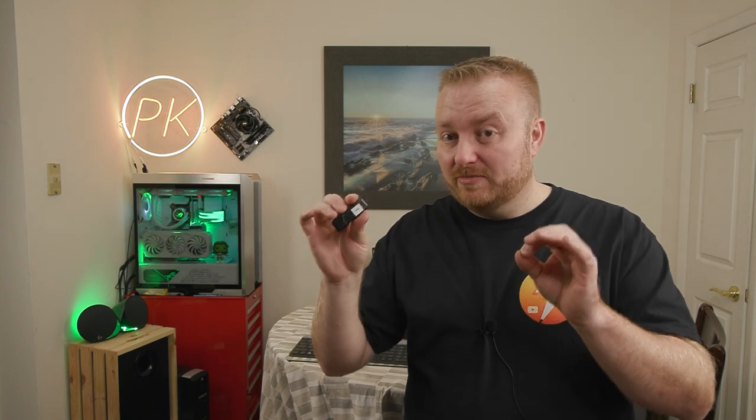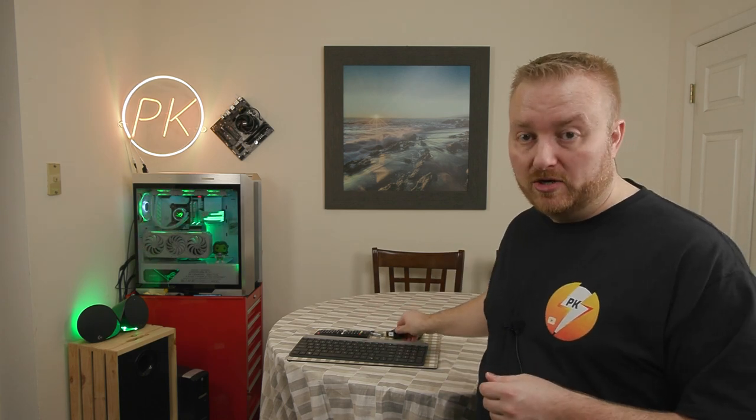It is that simple - it only takes 15 to 20 minutes to do it all if you're not shooting a video. Make sure it is formatted into FAT32 in a 16 gigabyte memory stick or smaller. Otherwise you could run into issues. The most basic things: is it FAT32? Is it 16 gig or under? You don't need anything better than USB 2.0 - not that you can't use 3.0, 3.1, 3.2, or 4.0, but they're unnecessary unless you just have one lying around.